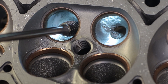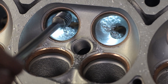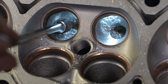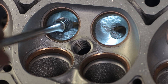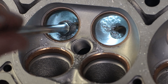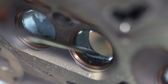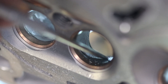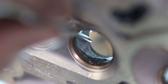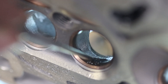Now let's go over what you've seen there, and this has just been by hand. I ported this area. You never want to go up here just because it's the wrong angle — you only want to go as far as the tool will go naturally. I'm just pushing with my fingers, and it only goes up to just at the corner of the short turn right into this area here. Then I ported the center, and that is how you blend it in. The issue with the short turns is they're actually not a turn right here — there's a big piece right here that stops the air from moving nice and smooth, and there's a big bump right here. So what we're going to do is blend what we were doing on the corners here, making this wider, and also making it a turn into the valve seat.